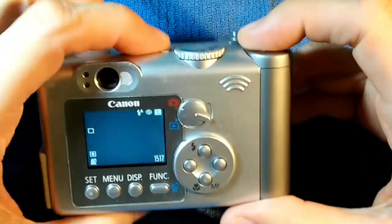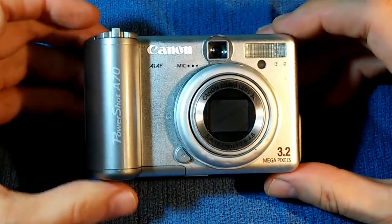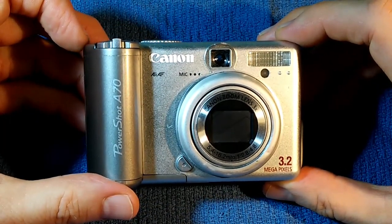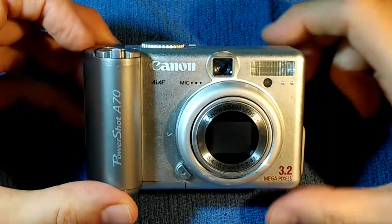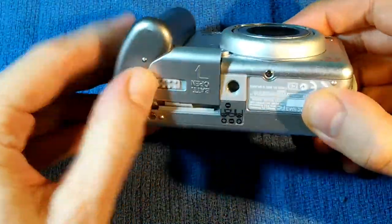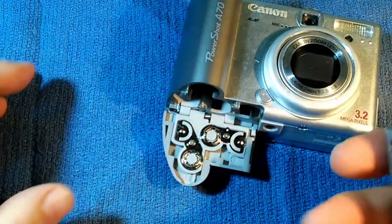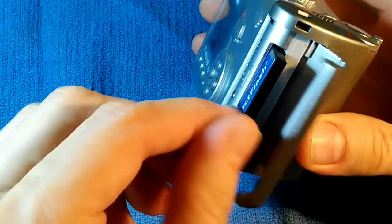We shall turn the camera off. There are a lot of screws that hold this thing together. They will either have a fine thread, anchored into metal, or a coarse thread, anchored into plastic. We'll begin by removing the batteries — it takes four rechargeable nickel-metal hydride batteries. Then we will remove the memory card by pushing the door forward and pressing the button.